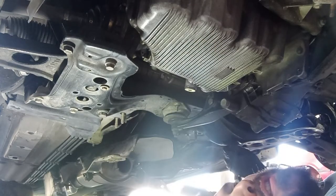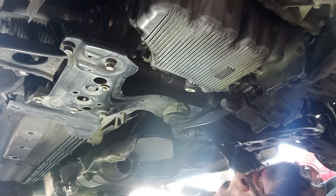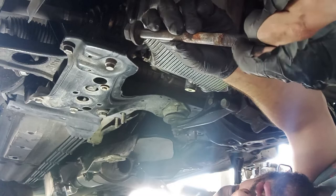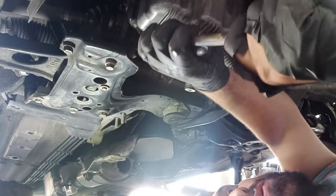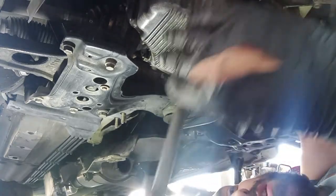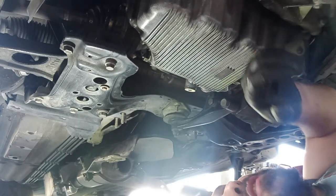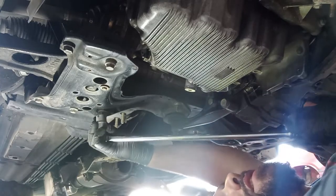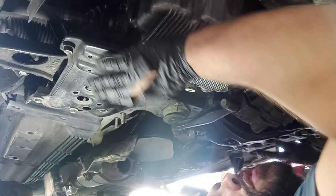These are the bolts for the steering rack, and they are always very, very tight because they are very long, so the impact gun cannot reach the thread itself. It will only work the bolt like this, okay? The bolt being so long, that happens a lot. And also water will enter through the top of that threading. A bit of anti-seize will be the best on that. I always do that. The subframe is almost off.